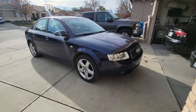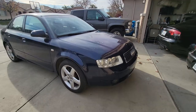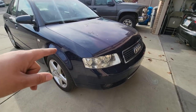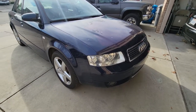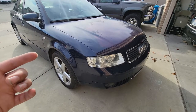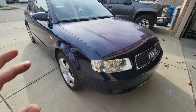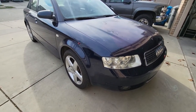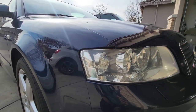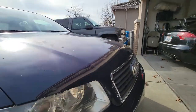So much cleaner. It's actually not that difficult — it does take some time, patience, and some finesse, but it's very doable. I actually did not take apart the lens off of the housing because the B6 has a perma-seal type of seal and it's very hard to take apart. The seal does not loosen up when you apply heat to it. So what I did was pop out the amber lens while everything is still intact — I cracked the lens in half and slid the pieces out through the cracks.